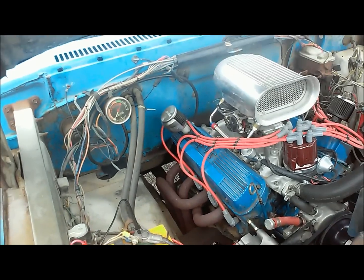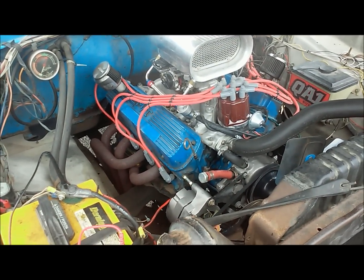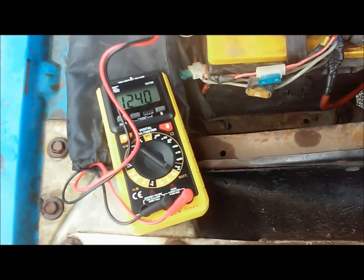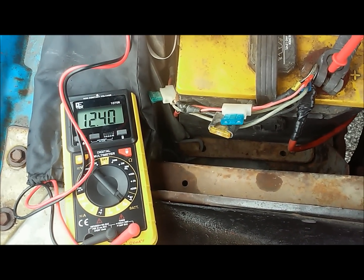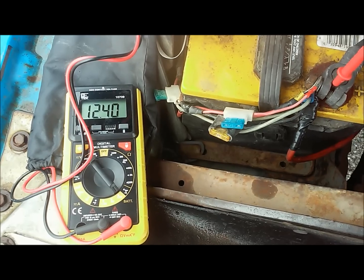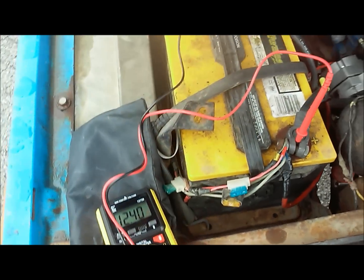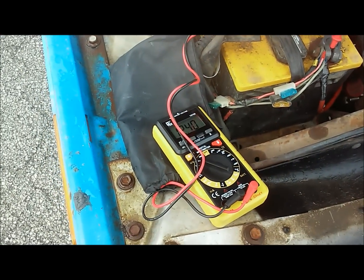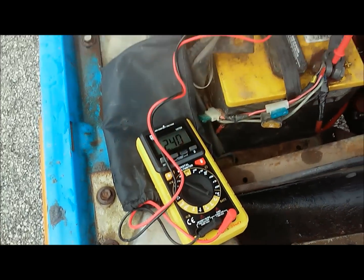And like you saw, the bleed down, where it's well above 12, almost to 13 volts, and it'll start dropping. We can see here that it steadies out, and I've done this a few days now. It's usually somewhere in between 12.4 and 12.5, and it's never really drawing any more power than that. Sitting for 3-5 days, it's always the same, somewhere between 12.4 and 12.5.